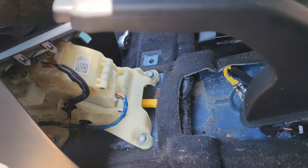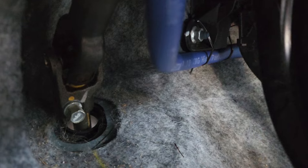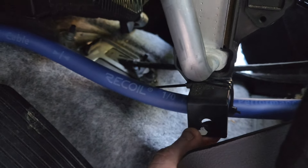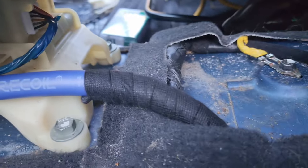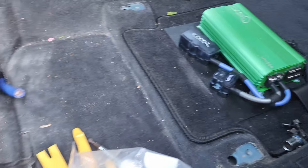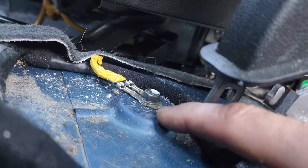Run your speaker wire and power wires through. I came through that grommet and wrapped around here. I made sure the brake pedal isn't going to press into the wire — it's not close at all. You can see the distance between them should be good. I double-strapped it behind the gas pedal — the gas pedal won't hit. Wrapped it around here, strapped to this plastic piece. Don't put it in the hole because you'll have to put the plug back in for this panel. Then I brought it right across these wires here and ran it down through where this vent goes. It'll come out and tie into that junction box right there. This thing is screwed down now, it ain't going nowhere. They've got a ground right here — I might use that, it seems pretty decent.